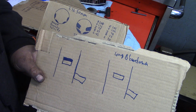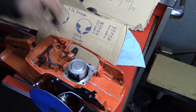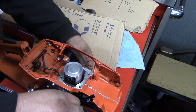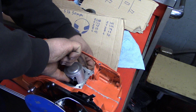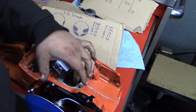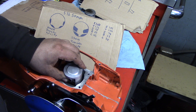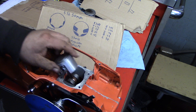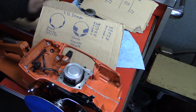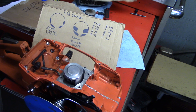It'll also create a better pull on your intake when you do that. Just visualize this piston coming down to compress. When you fill in your cases like this, you're actually losing case volume to gain case compression. There are reasons why I did it for this piston — I'll explain that in a little bit. The lower you have your transfers, the better case compression angle you'll have.